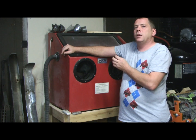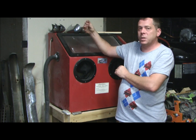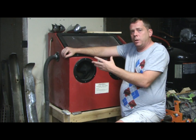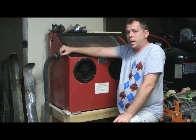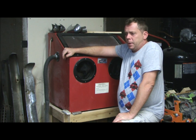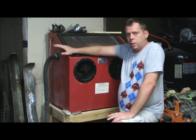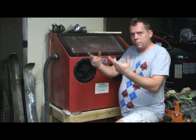In my first experiments I had my old little shop vac hooked off to the side, and not all the experiments were successful. What I found out is that because you're pushing massive amounts of air through your compressor, you have to be able to deal with that volume coming out, otherwise the whole thing clouds up and cakes up and you can't work. So we ended up buying a new shop vac — one of the really big Ridgid-branded stainless steel monstrosities. That's effective enough to pull enough air out that you can soda blast in a small cabinet. The main caveat is that soda will clog a filter very quickly, so you want to get or build a sock to go around the filter to catch the soda so you can clean it off and reuse the filter.